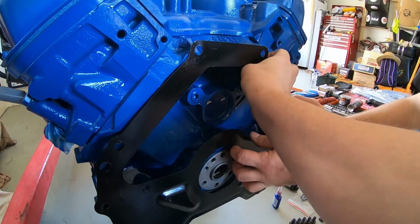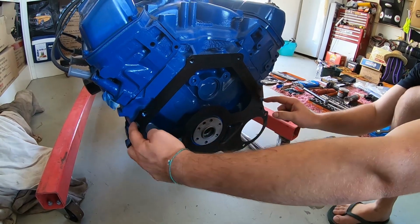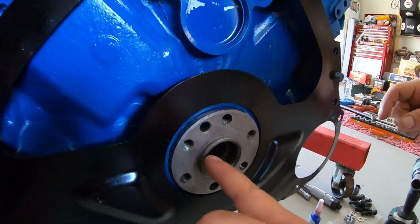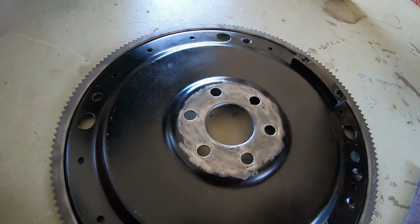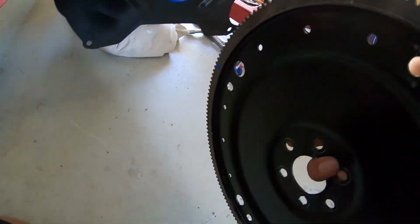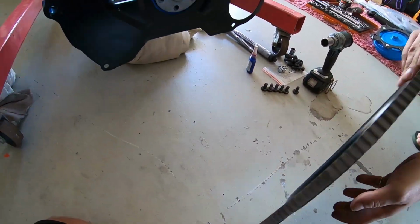Everything's been pre-cleaned and degreased, wiped down, we've checked the dowels, we had to make sure everything fits, so we've had to clean back the dowels, clean back the nose of the converter, grease here, clean back all the surfaces. Clean this, clean that. Alright guys, there's no shortcuts. As we said last week, these things go on one way.